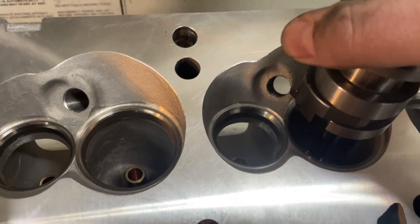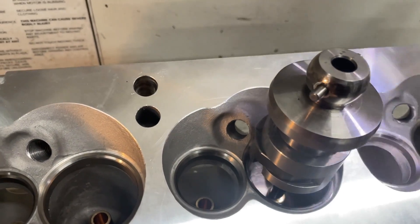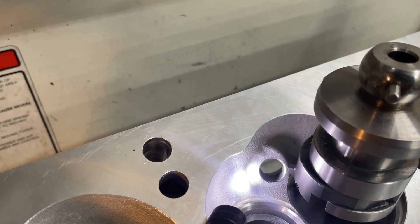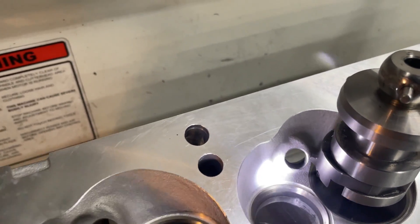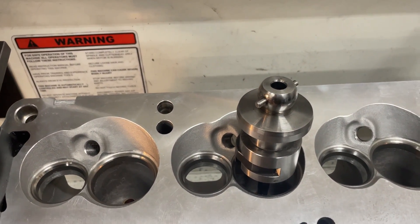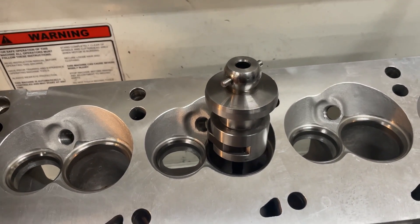More importantly, over here on the spark plug side — you can see we are pretty close to that spark plug boss. Don't get too worried though: LS's are actually closer, and that's the only way they manage it. So this being the first step, we're going to cut this valve job and try to fix a bad situation — and prove I'm not a superman.